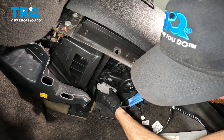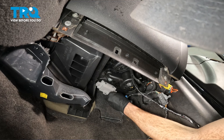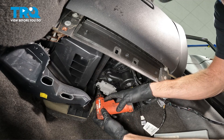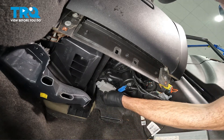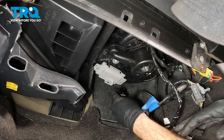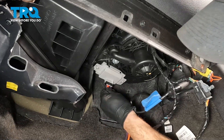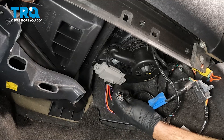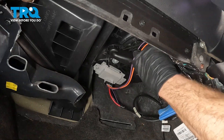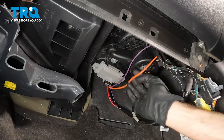We'll take this and put it underneath the dash and install our five and a half millimeter mounting screws. It can only fit in one way — if you have it backwards, just go ahead and turn it around. Start both of your screws before you tighten either of them; it's just a good habit. Snug them up, then take hold of it, give it a wiggle, and make sure it's secured properly. Now it's time for that wiring harness — looking at the connector port, it has an area that bulges out a little bit, and the wiring harness has a small tab. Align that and press it in, give it a wiggle, make sure that's secured. Plug in your blower motor, press that in and listen for a click, then give it a light tug.